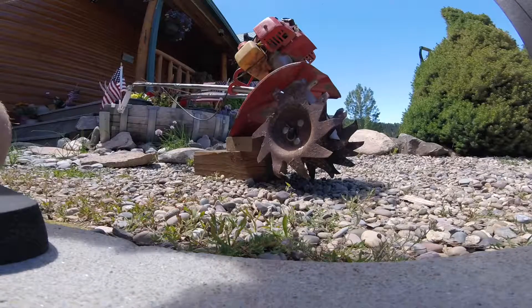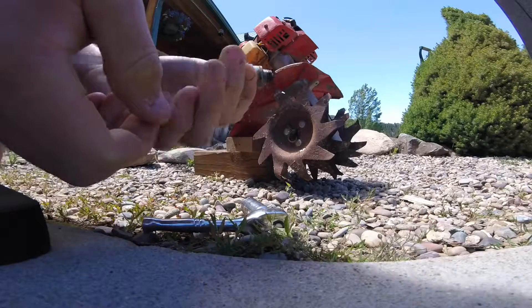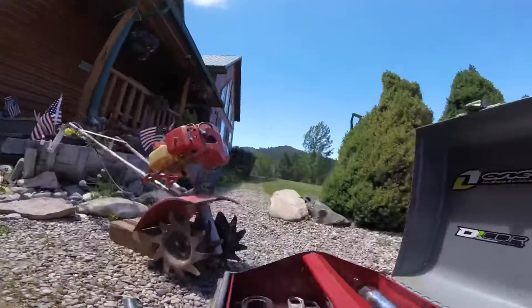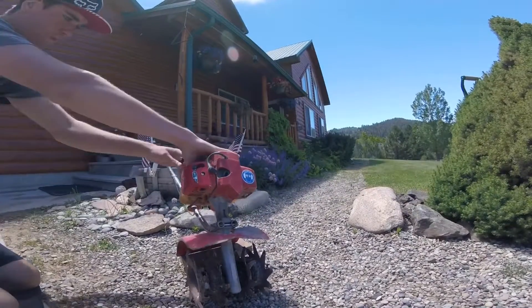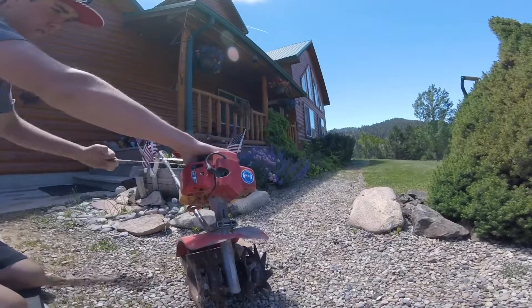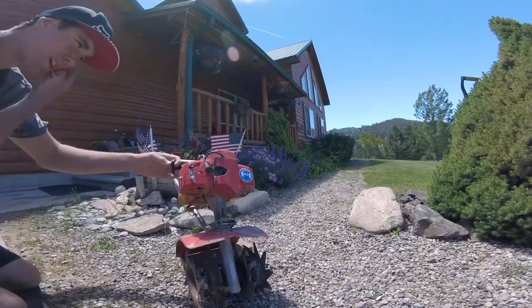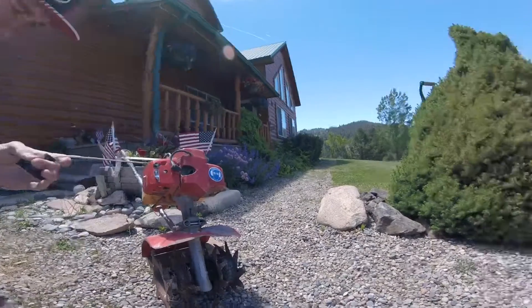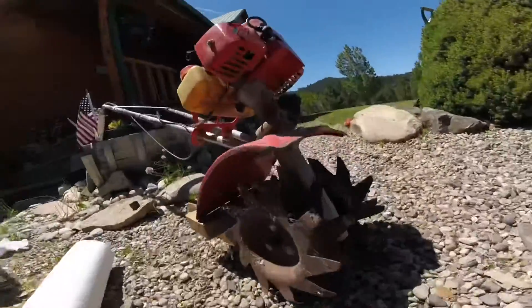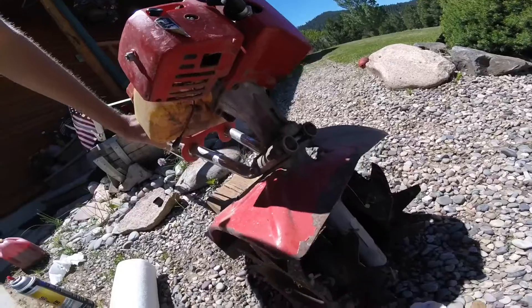I don't know what size it's going to be, but this one's pretty common for a small engine. Pretty good looking — doesn't look too rich or too lean, it's more lean actually. The pull rope retraction system's acting up, and the pull rope looks like it also doesn't have a lot of days left on it. I tried to do the spark test but it was wiggling a lot, so it was hard to tell. Don't think it does — the kill switch is off.